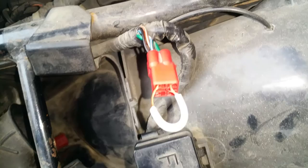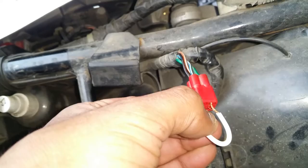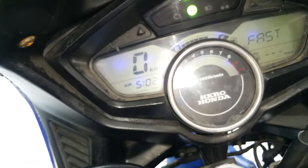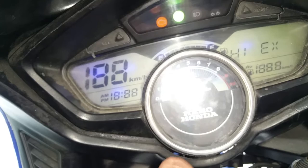Here's the correct way to reset your ECU: first, short-circuit the green and blue wires, then turn on the bike. Next, remove one of the wires and put it back within five seconds. The light is going to blink vigorously, which means the ECU has been reset successfully.